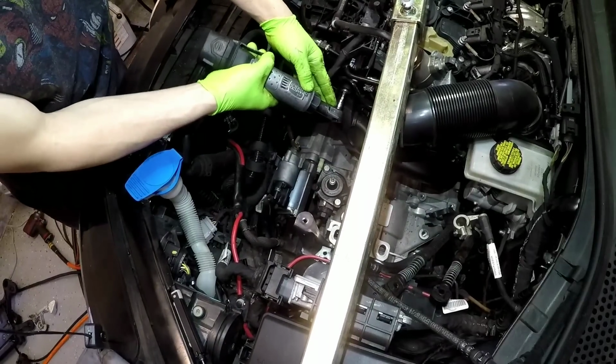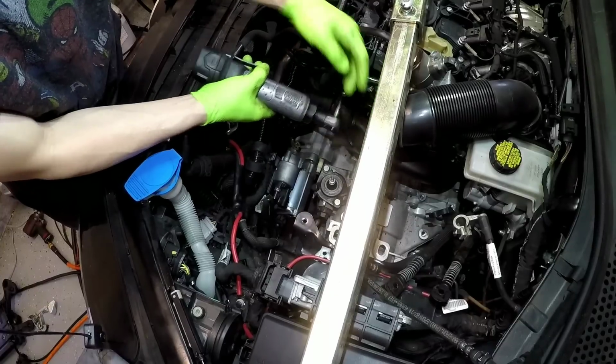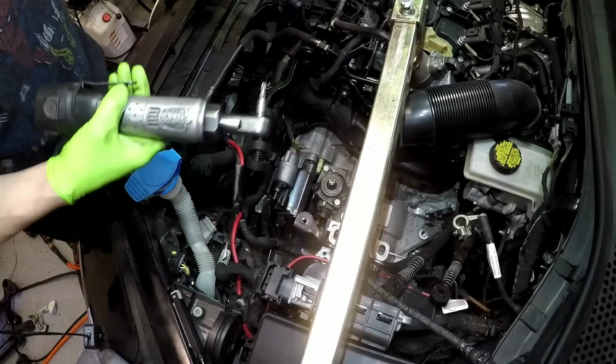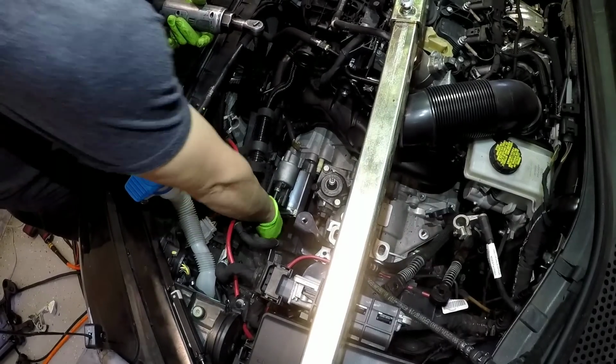One thing I also like to do is take this 30 right here, holding this turbo outlet pipe, because down there the transmission kind of hits it. There's two bolts holding it on, just so it lets you get a little movement out of it so you don't break anything. Okay, now we're ready to go underneath the car.